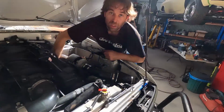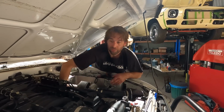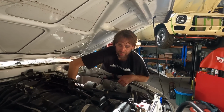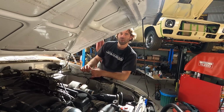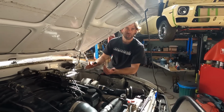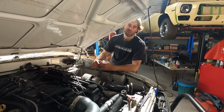So we don't know what's going on with the control module, the ECU, as far as the voltage. Did you sort that? No, I don't know. I've checked all of the battery and ignition ins are getting full voltage at the plug. Yep. So then I just did a couple of checks. The earthing in those pins seems to have had a fair bit more resistance than I would have liked. But I did a bunch of earth checks and it all seems fine, so I really don't know. I even tried another ECU. Yep. Other ECU is the same.